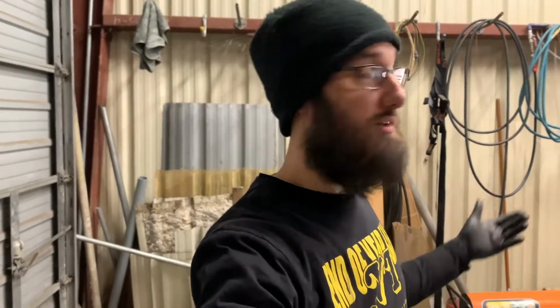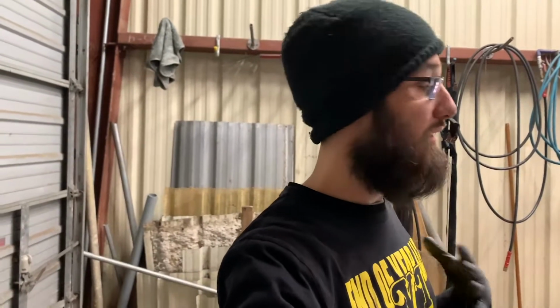Other than that, I think it went pretty smooth. I have to take my measurement for my drive shaft and bleed the clutch, all that stuff. I'm not necessarily worried about doing that today. I'm kind of tired. I'm pretty done. Muscling those transmissions out without a transmission jack was tough in itself. I would suggest getting a transmission jack for a job like this just to make it easier on yourself.